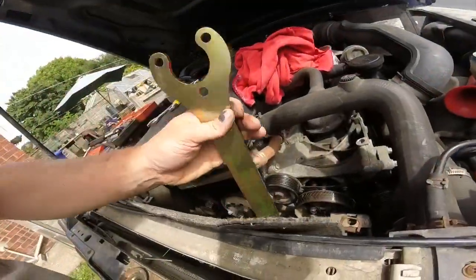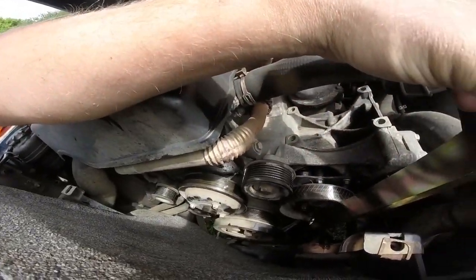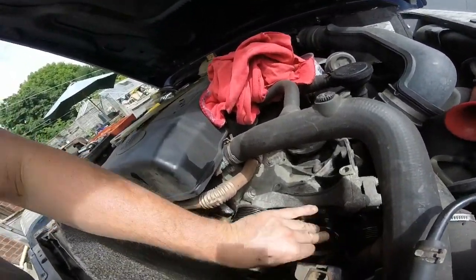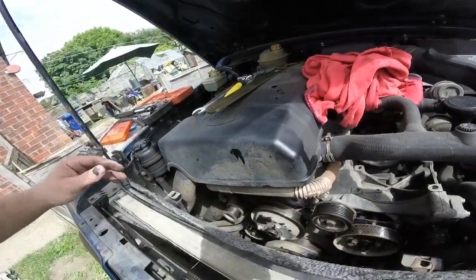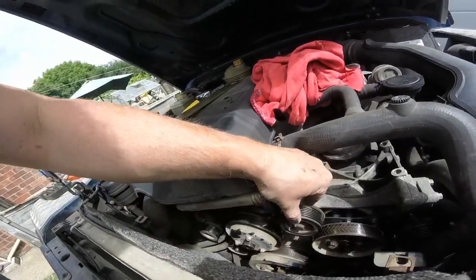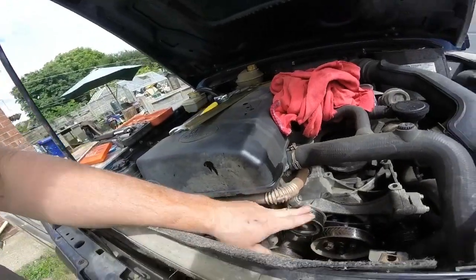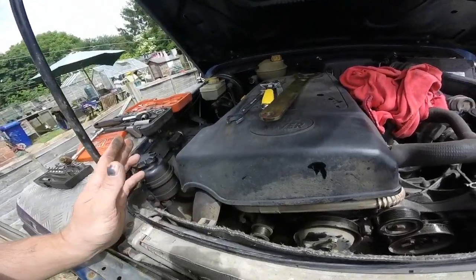Yeah, so when I was tightening them on there, I just held that in against the others like that as I was tightening each individual one, just so it couldn't turn, because they're a bit of a pain when they turn. You can't really get it tight, but it feels a lot more resistance on that now. The front head's a lot tighter, so hopefully that solved the problem there. Like I said, all them other ones seem to be running quite smoothly. No play on that. They're quiet, they don't seem like they're rumbling or anything. So the power steering side of things, I think, is done.